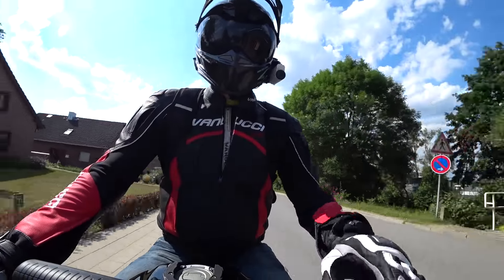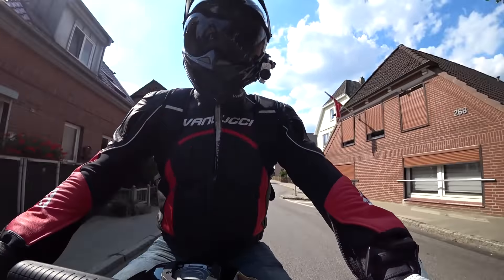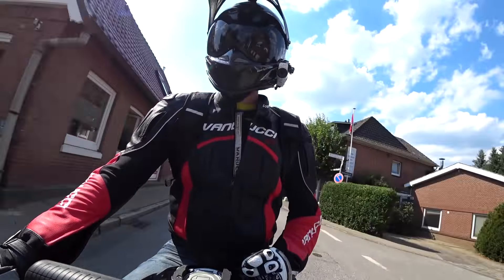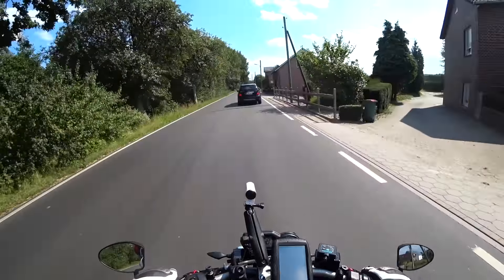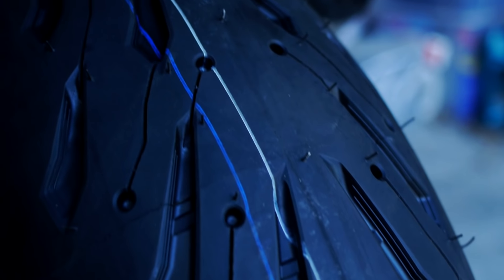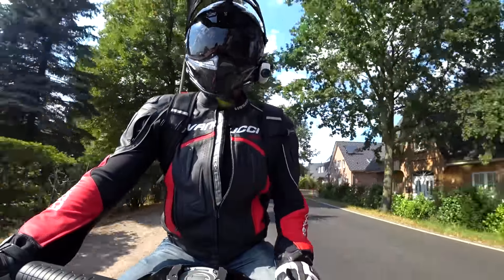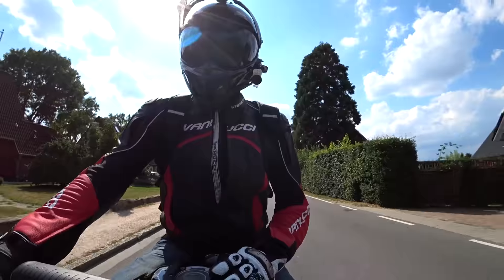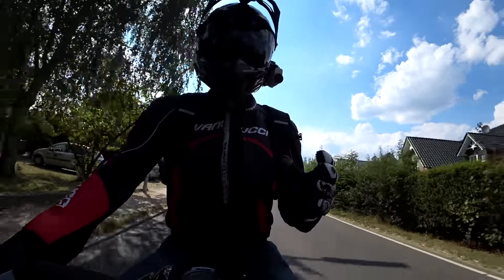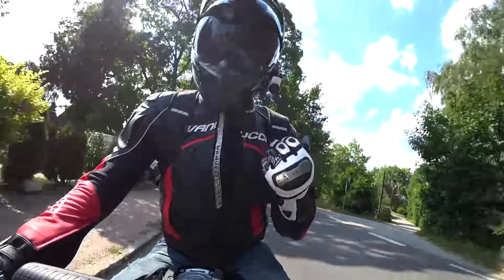While I'm scrubbing the tyres in I'm not going to be pushing the boundaries of traction and feel, but I can tell you a little bit about the tyres and what potentially makes them so good. The first thing you'll notice is that crazy tread pattern, which I actually think looks really cool. This new tread pattern is a combination of newly designed wells and sipes designed to break the surface tension of the water on the road and disperse it from the contact patch faster than ever before.